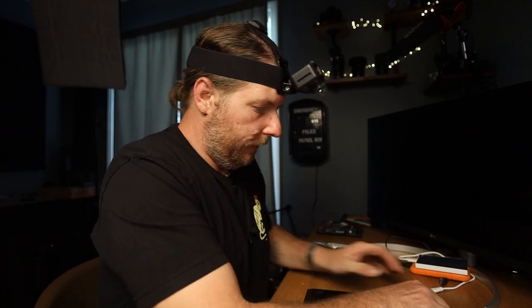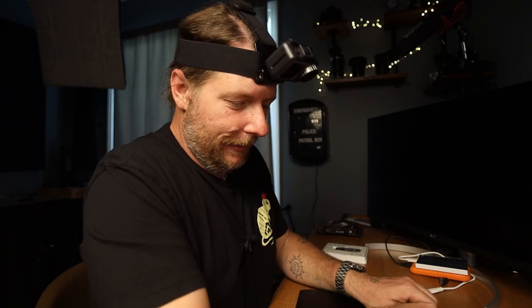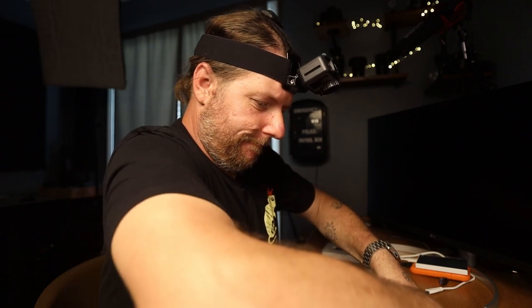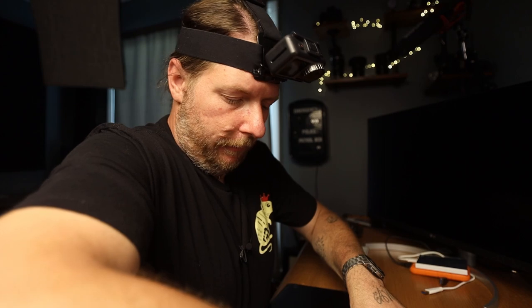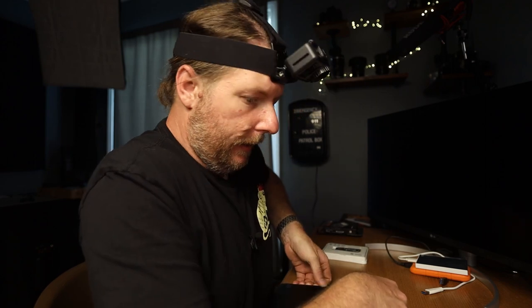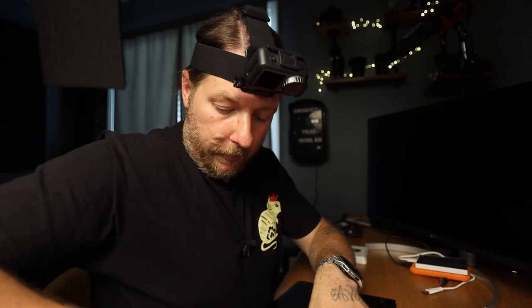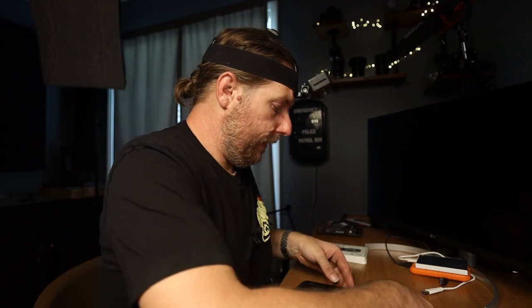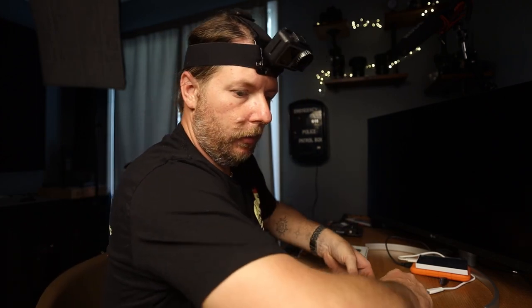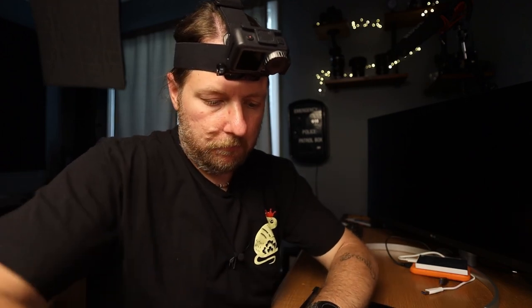Also, while I'm popping this off, on the video I did about editing with the Galaxy Book Odyssey, I was using the free version of DaVinci Resolve. Well, when I had to install it back onto this laptop when I got it back because they wiped it, I went ahead and bought the paid version, DaVinci Resolve Studio. The reason I did that is because I didn't know this, but the free version relies on your CPU. It's not using your GPU for editing, for rendering. So basically, I was doing it without a graphics card or whatever the built-in graphics card is.